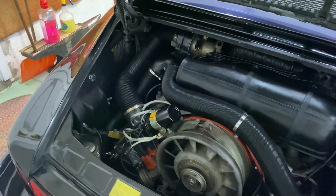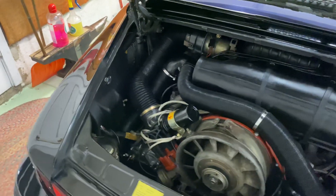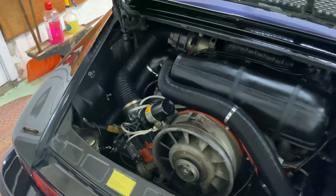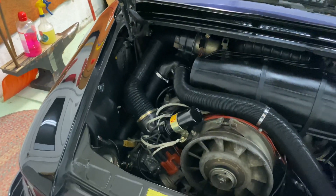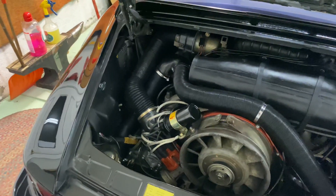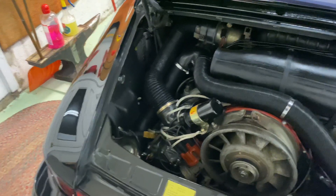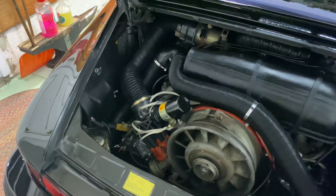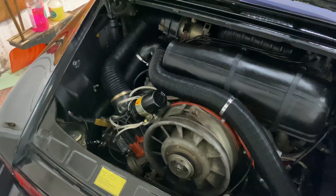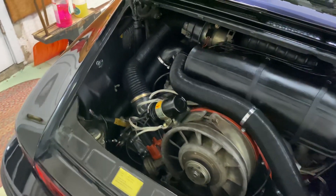There were no electrolytics in the one underneath the seat. I looked through it, it looked very nice. I just cleaned the terminals with good quality contact cleaner and put it back in. Lauren said nine times out of ten you'll never have any trouble with that. It really only controls the idle a little bit and the oxygen sensor — which isn't that prevalent on a car this old, a 1980.